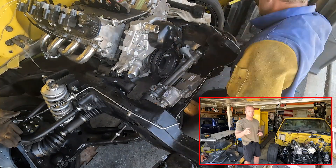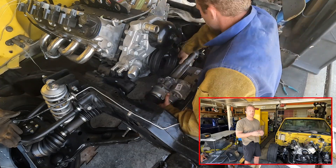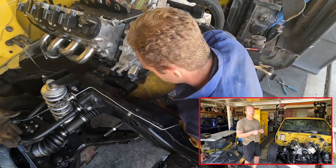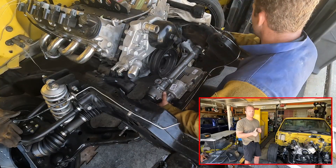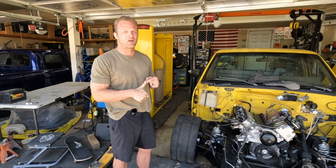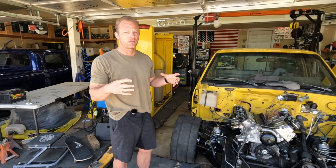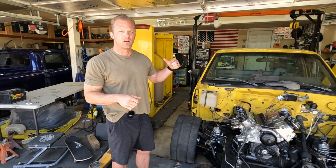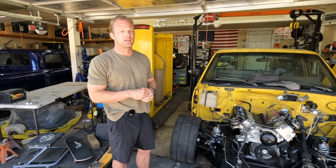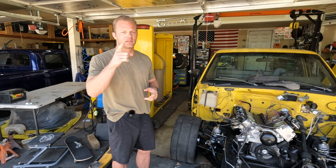So today, what are we gonna do? We're gonna do something very unique. A lot of guys have kind of been talking about it - I've put it out there. We're gonna try - I don't know if it's gonna work - but we're gonna give it a shot to pull a modern muscle car electronic power assist steering rack and pinion and get rid of all the old junk in here: the steering gear, the pitman arm, all the tie rods and ball joints, as well as the pump and all the accessory stuff on that engine. It's gonna reduce a lot of weight and give us electronic power steering. So let's dig into it.